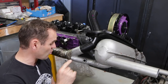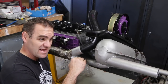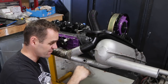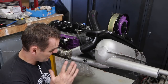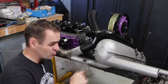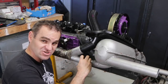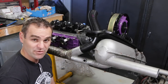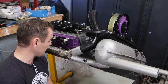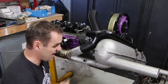Something that was brought up in the comments last week: the oxygen sensor bungs I put on need to be at at least a 10-degree angle so that any condensation can drain from them, otherwise they won't last very long. I checked — the other side is good but this side is definitely too level. So I'm going to try and cut it off, tilt it just a little bit, re-weld it, and sort that out. Thank you for pointing that out — I am a complete noob with all this stuff.